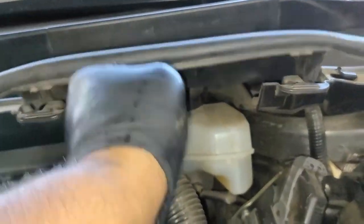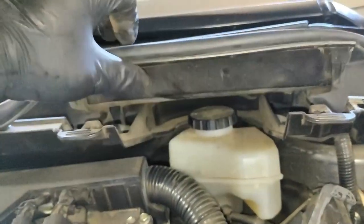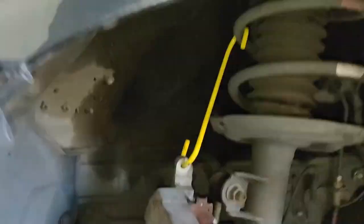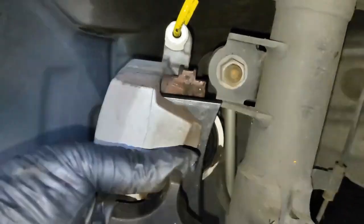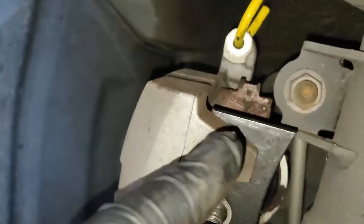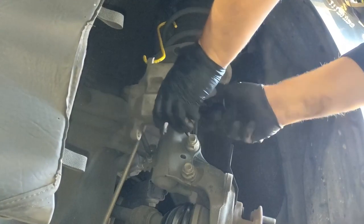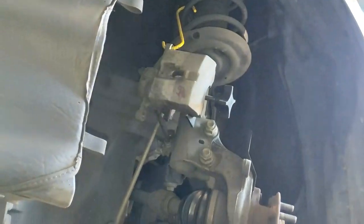Before compressing the piston, come up to the brake fluid reservoir — there are two tabs — and loosen the cap. Don't leave it off, just set it on top, because you really don't want moisture going in there. Now compress that piston back straight. You could use a C-clamp or one of the spreaders I showed earlier, and I'll have links to those tools in the video description.